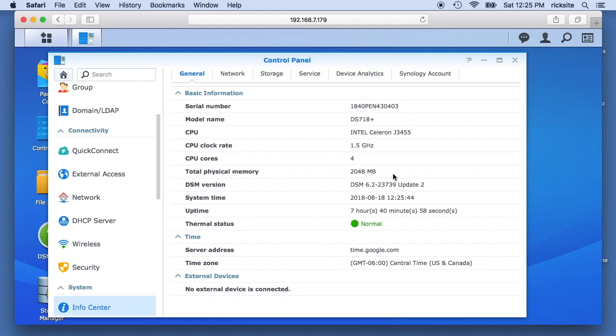I'm going to install the RAM, then we'll come back and see if it's recognizing 16 gigabytes. I'm actually only going to keep a 4 gig module in long-term, but I'm going to put 16 gig in just for testing. The reason you would potentially want 16 gigabytes of RAM is if you're running virtual machines — you could pull up a couple, give them each four gigabytes, and keep some RAM leftover for the main system. I can't imagine needing 16 gig just for file services, but if you're running a lot of different services, having more RAM is certainly useful.